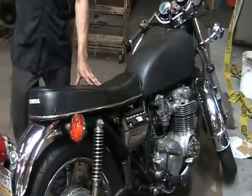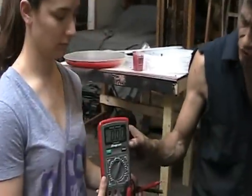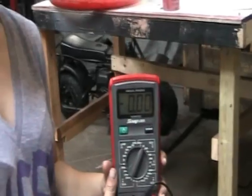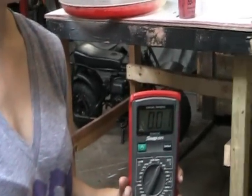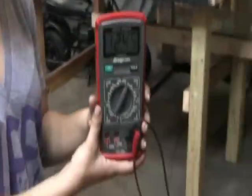What we're going to show you now is we're going to establish a baseline with an entirely different motorcycle. This is a similar bike, a CB550. Sophie here has the meter. Our meter is on the 20 volt DC range. This is to establish that our meter is working properly — keep your focus on the numbers.